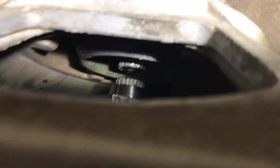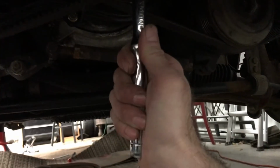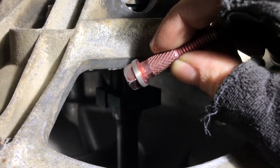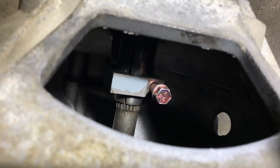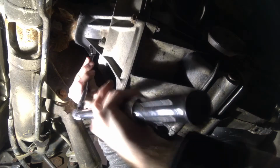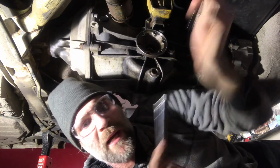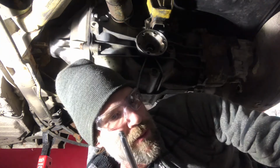Okay, and now then putting on this coupler. Put a wrench on the front of the crankshaft and do it like this. That's the way, I like it. Oh yeah, look at that. Custom craftsmanship. 80 Newton meters. That's the torque spec, in case you were wondering. Probably weren't, but in case you were. Oh, feel the click. I have to switch to my 13 millimeter because I used a different bolt.